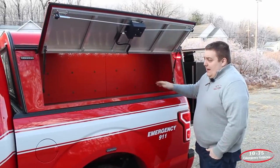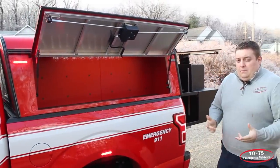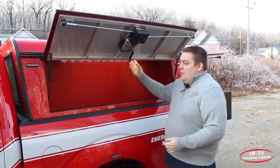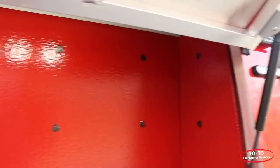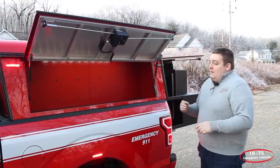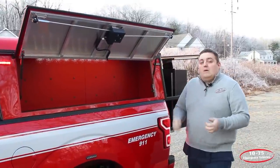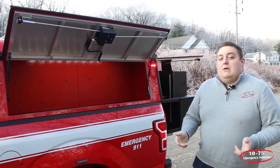Taking a look at the side compartments of the cap, we've installed pin switches on all the doors. They serve two purposes: one is they activate the interior compartment lights — single white lights in the side compartments and red-white in the back. The pin switch also tells the blueprint system to turn the light on. We've tied this into the Park Kill signal using the matrix, so that if you have a compartment open and put the car in drive, the control panel will beep to let you know that you have a door ajar.